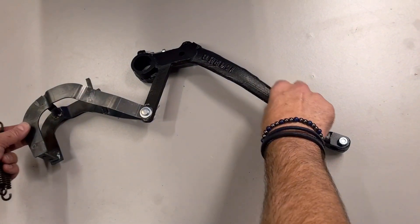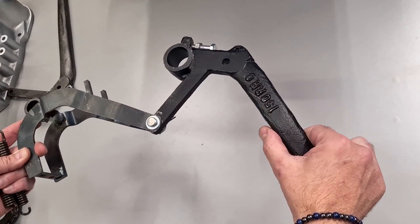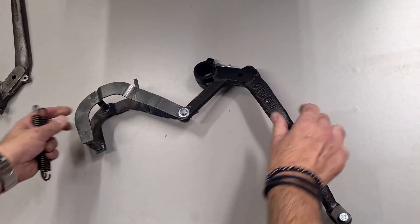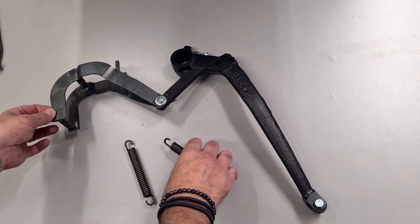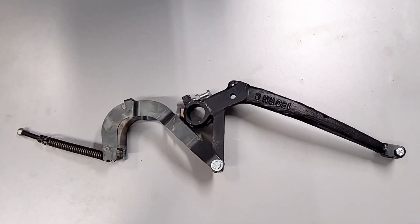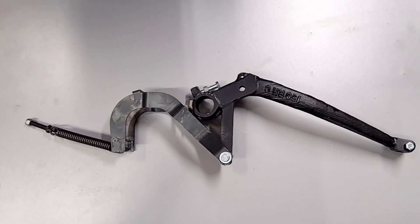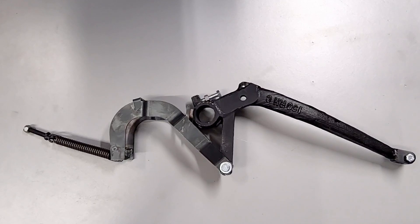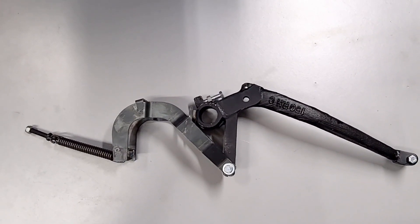Here's one I made earlier. As you can see, we've replicated this pedal — there are two versions: this is the right hand drive, and there is a left hand drive version that does have a different angle to the pedal stem. We've made the springs and the brackets, and there's plenty of information about this on the shop with photographs of it fitted to vehicles. This is a beautiful and simple engineering solution that was used on a few of the last cars, which we have now mass produced and developed so that you can have it on every single one of your XK150s to ease your clutch and take the pressure off your legs.